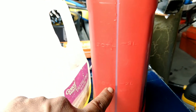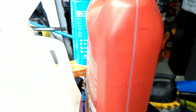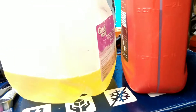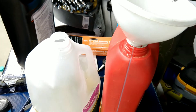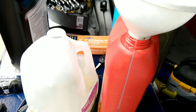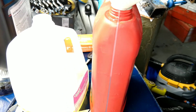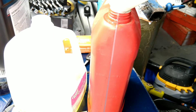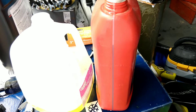I've taken the coolant out and made it a 50/50 mix — about 50 percent concentrated coolant. I'm going to fill this back up with distilled water to the line. That gives me the precise 50 percent. The radiator has completely stopped dripping now.